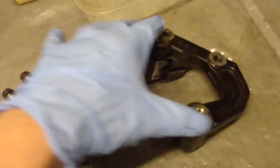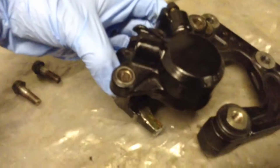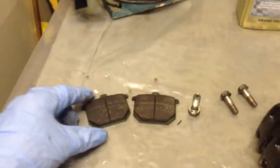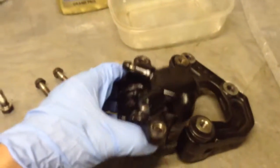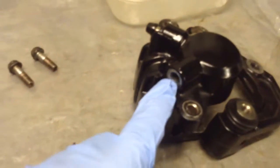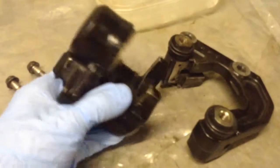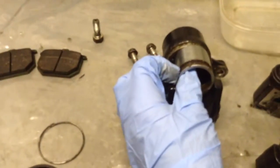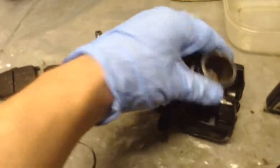So I've wrestled the calipers off the discs and taken that one off. They're quite easy to get off, to be fair. All you do is undo the two bolts on the slider pins. Then you can essentially move this out of the way or pull it completely off. The pads are literally just sat in there loose and just sort of fall out. You can still have the hose connected by its banjo joint and banjo bolt. Then essentially what you can do is pump the brakes — the system will just push the piston all the way out. It comes all the way out, all the fluid gushes out the side and it just pops out.